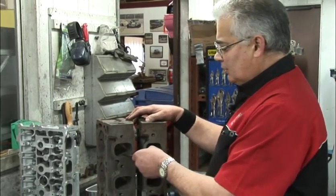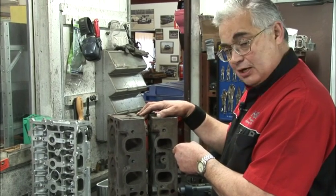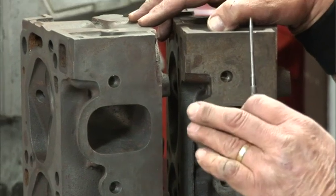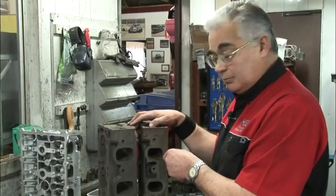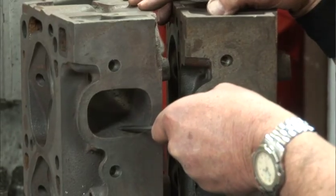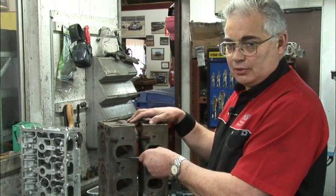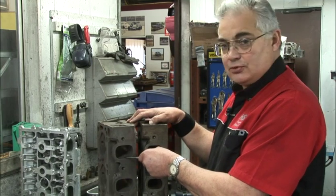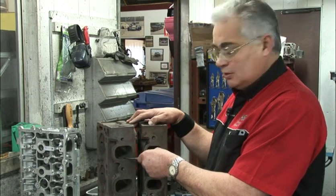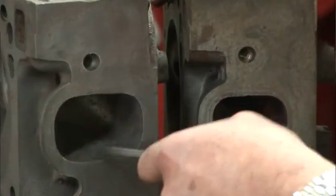Here we can see very clearly the difference between a 351 4V cylinder head and a 351 2V cylinder head as cast. The 302 or 351 cylinder head in fully modified condition will make around 500 horsepower. It'll have good bottom end and good mid-range, good for towing. These cylinder heads, the 351 4V, which came out on the GT and the HO, will produce excellent horsepower, up around 600 plus horsepower, but you do suffer lack of performance from about idle up to about 3000 RPM. These cylinder heads really take off after that sort of RPM and will run right through to 600 horsepower quite comfortably.